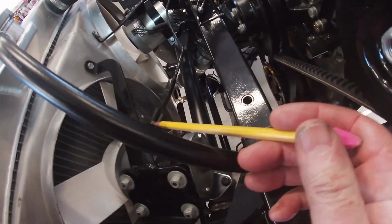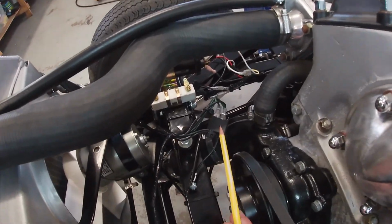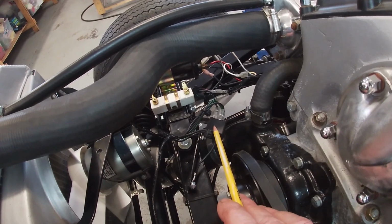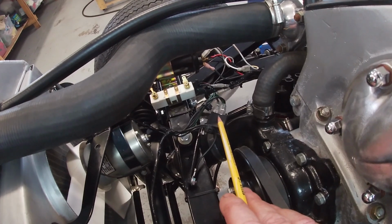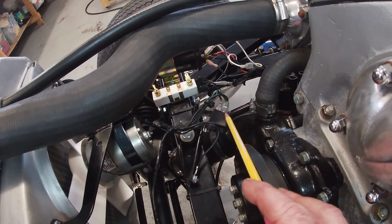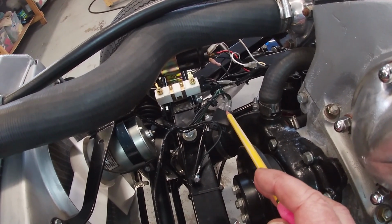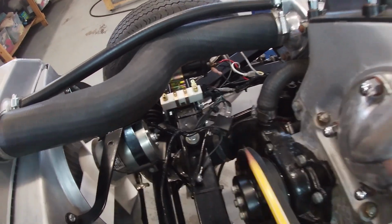My wiring is connected in. The heater relay, the fan relay. This is the part that came when I ordered that, and I followed the wiring instructions of how to connect that, so it doesn't have the C1, C2, W1, W2 notation actually on the relay itself. It's got different configurations, but there's an explanation chart of the equivalent of the C1, C2, etc. And so I've connected that up in that particular way.